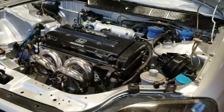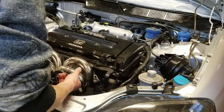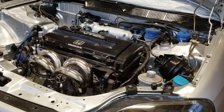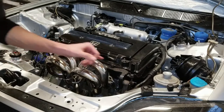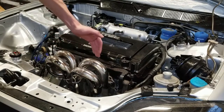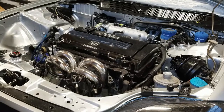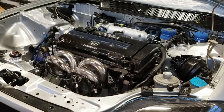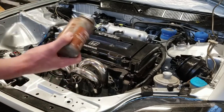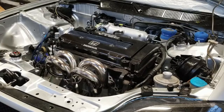It's a little bit too close, so we just took the bolt out and ground it down so this can clear the bracket, because I want to keep the power steering. And honestly, even without this bolt it's super secure — it's got a bottom mount. I really think it's gonna work just fine. Now we've got the manifold on with the gasket. I'm going to hit the bolts with some anti-seize and lock this thing in place for hopefully the last time.